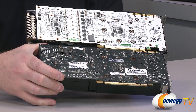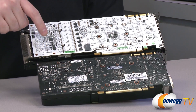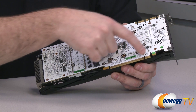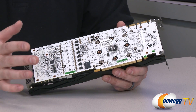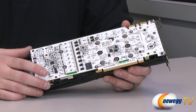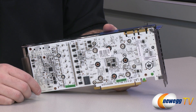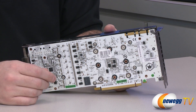Comparing the two side by side, you can see on the right side of the card some of the custom work — it's a bit longer with extra power delivery components added. Down here you can see the PCI Express Gen 3 connector, which is physically the same as Gen 2, so don't worry if you have a Gen 2 motherboard — you can still install this card. Gen 3 gives a bandwidth and efficiency increase, but the actual frame rate bump is negligible in pretty much every test.